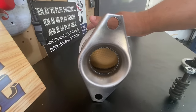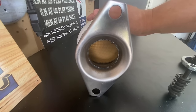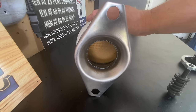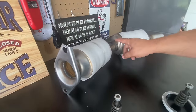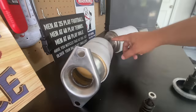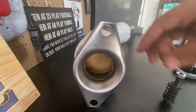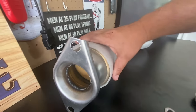These sorts of catalytic converters are often referred to as '90-day catalytic converters,' and they may even keep your check engine light off longer. The real magic on why these aftermarket catalytic converters work comes down to the oxygen sensor hole, and I'll talk about that a little bit later.